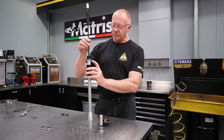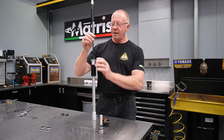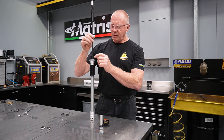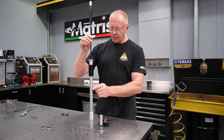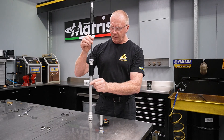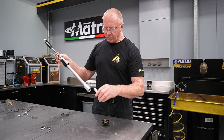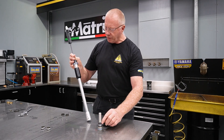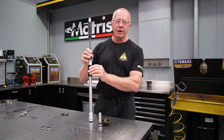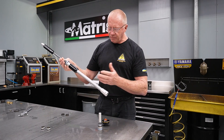What's different with this one is the top of the cartridge is actually sealed against the inside of the chrome tube, so that makes one chamber above the spring seat. We have an internal seal that separates the top chamber from the lower chamber where all the damping is created. I've got the base valve out of the fork — that would normally screw in. There's your compression valve here. This outer chamber is considered another chamber, and we have the pressure chamber here as well.